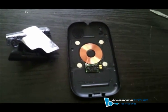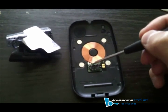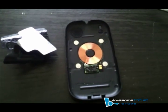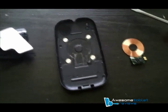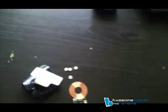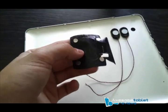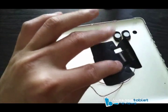Next, remove the actual board. This coil is connected to a PCB which converts the power to 5 volts. Remove that. Then remove the magnets. Now that we've removed all the components, we can throw away the back cover. Put the magnets onto that little sticky cover — this is the direct imprint of what it'll take to match up with the dock.